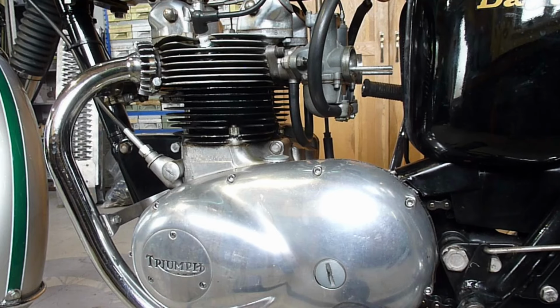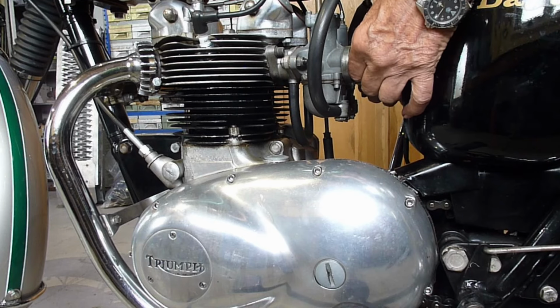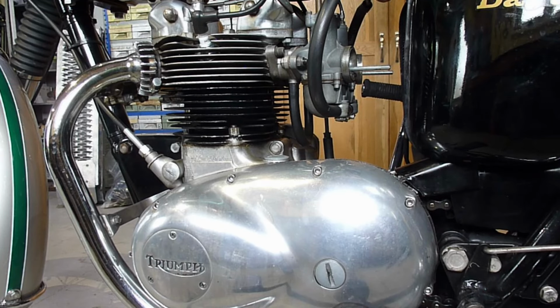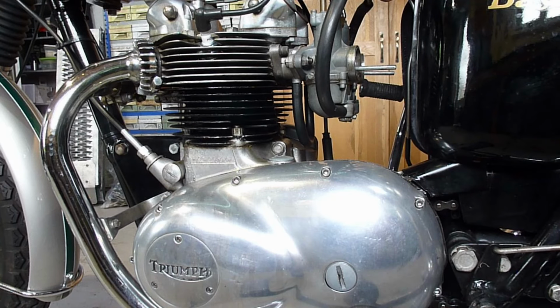Okay, obviously I've had the air boxes off, so the rods are in. I've just pushed them in just under the back edge of the slides, suitably armed with my 2BA and little shifter. So let's just have a look. They should drop together, but obviously this one is lifting slightly before the other, so I don't know which cable's which.